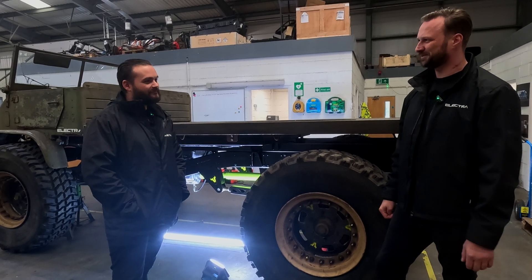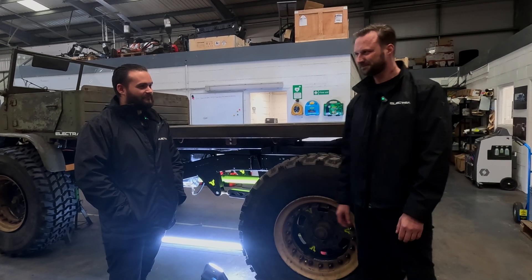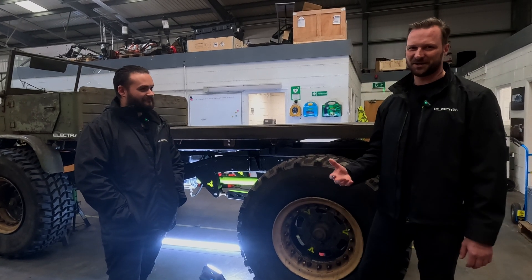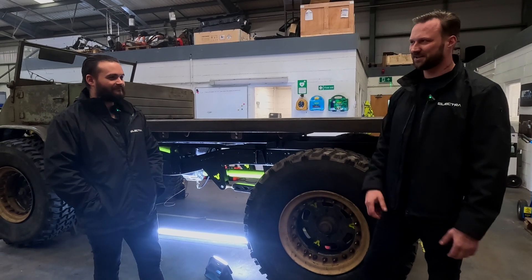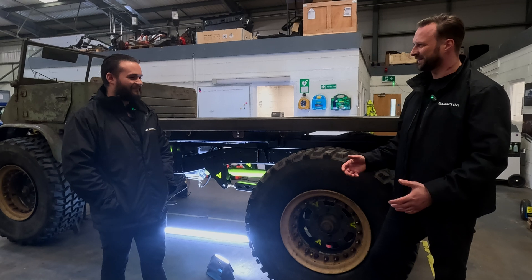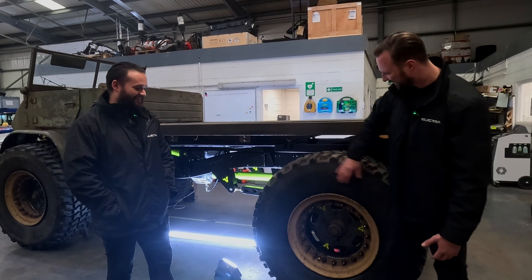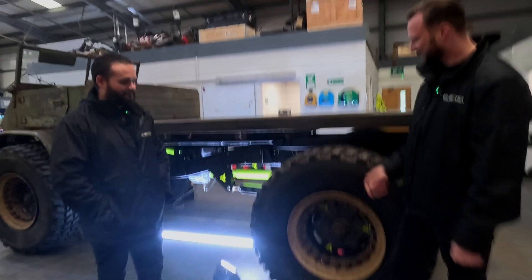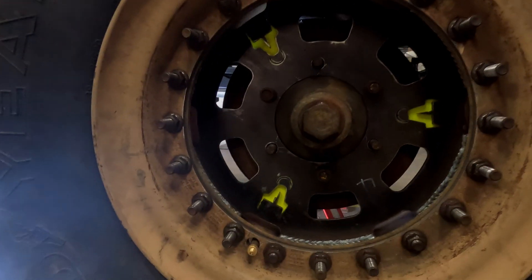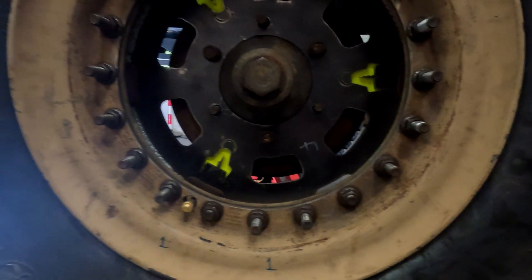Naively we didn't put two and two together that they had a rubber run-flat band inside. When the show was about to happen, the tire fitters came and said you can't use these tires — they've got a run-flat band in. We didn't let that stop us, so we went on YouTube and worked out that if you sit an engine crane over them you can reach inside and pluck them out. We did that, but then it turned out they didn't fit onto the solid rims we had.